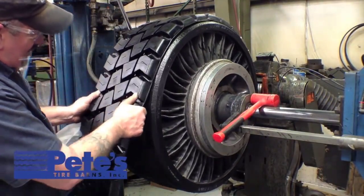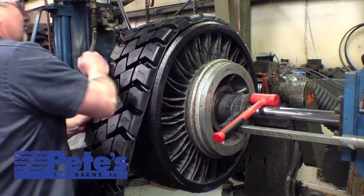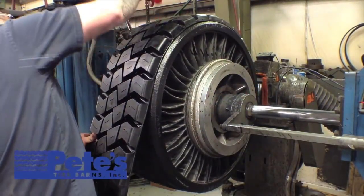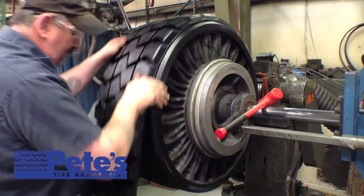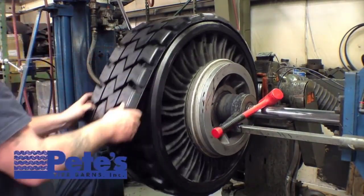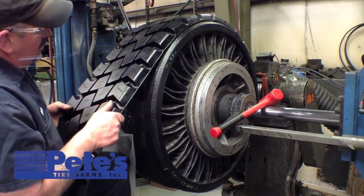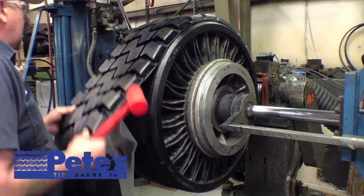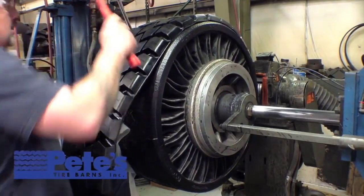The filled Michelin Tweel then undergoes a curing process where the rubber material is subjected to controlled heat and pressure. This curing process is essential for the rubber to achieve optimal hardness, resilience, and adhesion. The Michelin Tweel spends more than 4 hours in this controlled environment, allowing the rubber to bond seamlessly with the existing structure and the bonding agent. The extended curing duration ensures that the retreaded Michelin Tweel emerges with the strength and durability required to withstand the challenging conditions of its intended use.